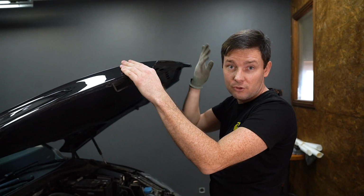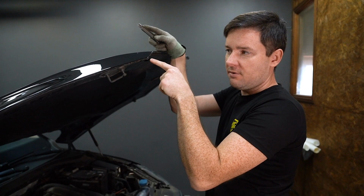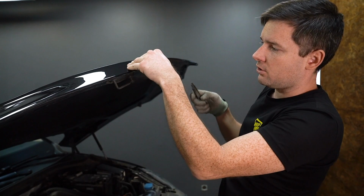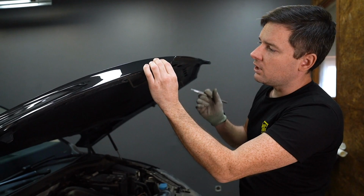The main thing is to do these corners. Everything that is straight, we're gonna do later. For example, I did this corner, I applied, after I push this film down for the flat, now I want to do this corner, and then I will push film this way and this way. Because there's no tension, let's do this kind of moon cut.